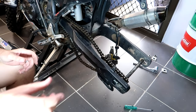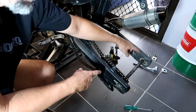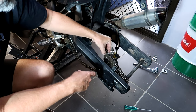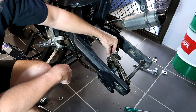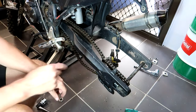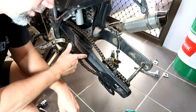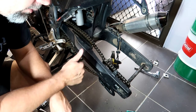Just to quickly reiterate what I did there: wheel off, axle back through the swing arm, a pair of vice grips on both sides of the chain - locks it. That works. Probably not recommended if you're keeping your chain, but if you're changing it and you don't care too much about it, go for it.